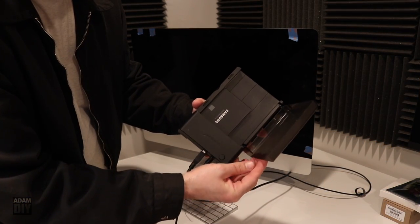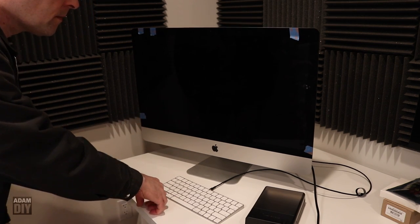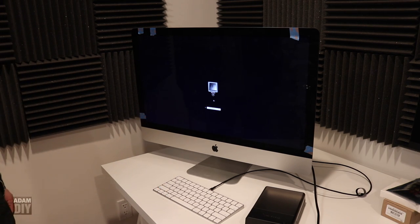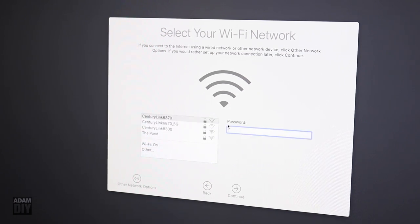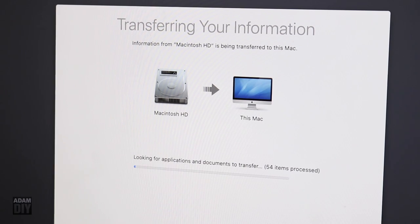If you want, you can put it in an external case and run it through USB — that's what I'm going to do right now, and then transfer off all the data from my old Mac. By default, the Mac is going to boot off the internal hard drive, so we need to tell it to boot off the USB drive. Right after you turn it on, hold down the Option key, and any drive hooked up to your computer will show up and ask you which one you want. Select the external drive, enter your Wi-Fi settings, and go through all the regular steps you would when setting up a new Mac. When this window shows up, you have the option to transfer all your data or some of it — I'm going to try and grab everything. This is going to take about seven and a half hours.